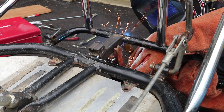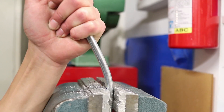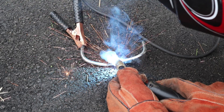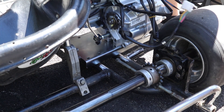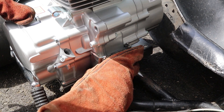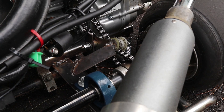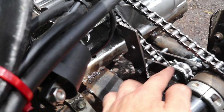I started off first by taking this rolling chassis and mounting a bracket in the middle to hold the brake pedal, and then made my own clutch pedal from scratch. Then I focused on engine positioning and mounted the engine by welding a plate fixed to the go-kart in the only spot that I had, which made it difficult to tighten the chain. Eventually, a chain half-link was the solution to my problem after trying several different chain tensioner designs.